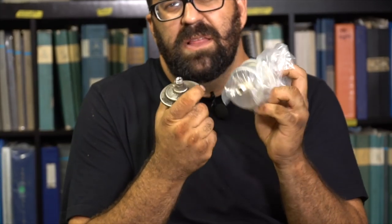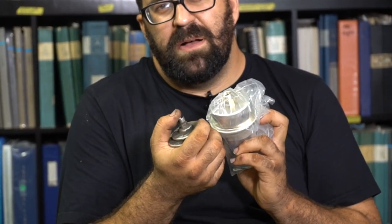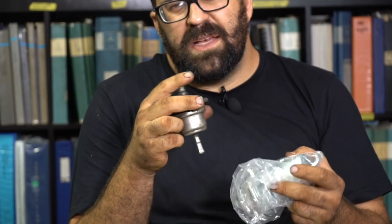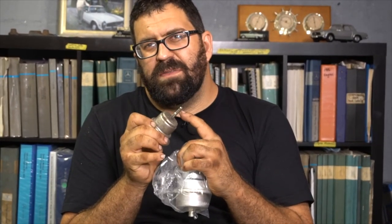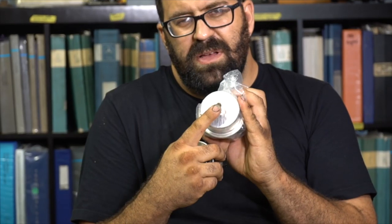How do these things work? They live down by the fuel pumps under the car, and fuel pressure is forced into them by the same pumps that fill up the filter and the fuel system. They're connected through a little metal line to the fuel filter and fuel pump supply pipe. As these things pressurize, any excess fuel is returned via the return line to the fuel tank. However, this return only comes into play at working pressure, which is something like between 5.5 and 7.0 bar. Any excess fuel below that pressure will stay in here, providing a continuous reservoir of pressurized fuel that is ejected through a tiny little hole in the nozzle of the accumulator.